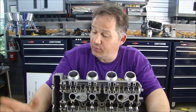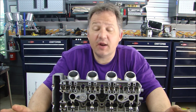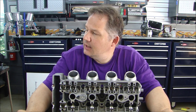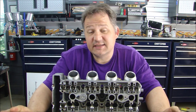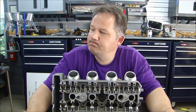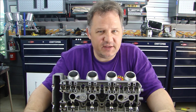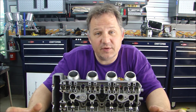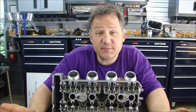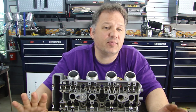This is where I am with this whole engine teardown. I had the cylinder head all torn apart and looked at all the parts with a 10-power eye loupe. I didn't find any cracks or any significant damage to any parts. I didn't find any significant damage to any of the seals. The only thing I did find was some very fine metal chunks — almost like something extremely brittle broke and scattered some fine particles. I didn't find enough of these little pieces to make up any sizable thing, so I'm not absolutely certain what it is. Nothing is missing, nothing is broken.